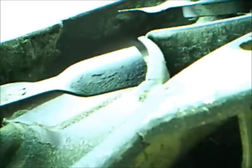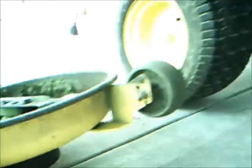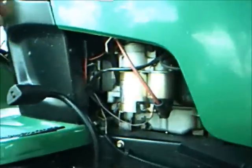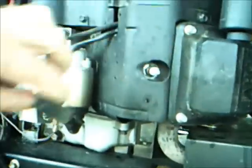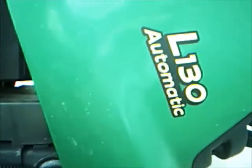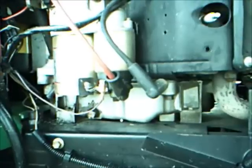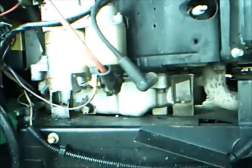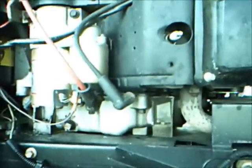That's basically the long and short of it. One thing I forgot to mention: it's probably best to remove your spark plug connections when you're doing this. Just raise your lid and pull the spark plug off — there are two, one on each side for mine. Mine's an L130 automatic, 23 horsepower. Remove them just in case, because when you're dealing with that drive belt there's a slight possibility you could turn the engine over. Not very likely, but hey, it's best to be safe than sorry.